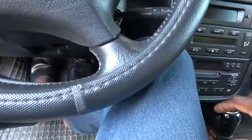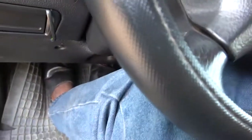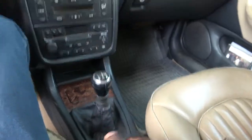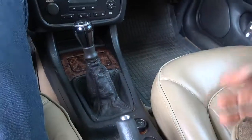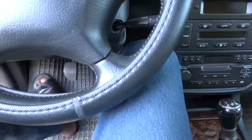First thing you do is make sure the clutch is pressed down to the floor while the brake pedal is also depressed. Then, as it's on gear one, you either put it on neutral and pull the handbrake up, or while it's on gear one, pull the handbrake up before you release both the clutch and the brake.